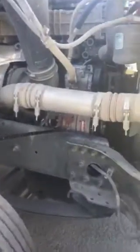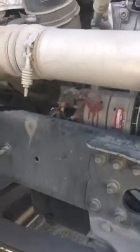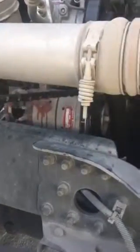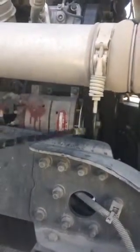Going on to my alternator — it's not damp, cracked, broken, or illegally welded. It's tight and secure with its full set of nuts and bolts. Checking my wires to make sure there's no bare wire showing that could cause a short. Going on to my serpentine belt, making sure it's not worn or torn — not too tight and not too loose. Too tight could ruin the bearings to my components; too loose, it could slip off and not work properly. I should have no more than three-quarters of an inch of play between my two pulleys.